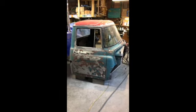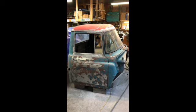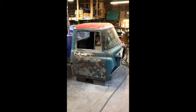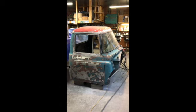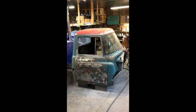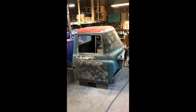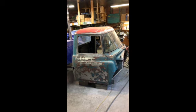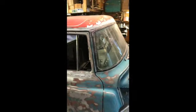All right guys, we've got everything sanded — literally around ten hours of sanding. As you know from the last update video, I had the filler on and sanded with 36 grit just to cut the filler down. Yesterday I prepped the new door on the driver's side and also sanded the cab over and over. We went from 36 down to 180, then jumped to 220, then lastly down to 400 grit.